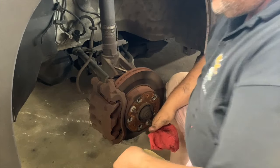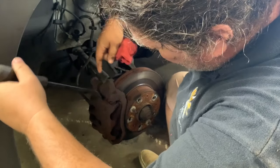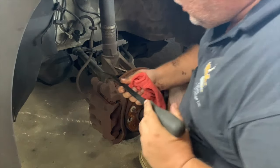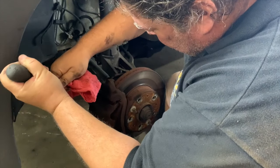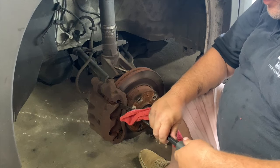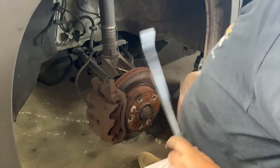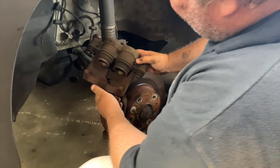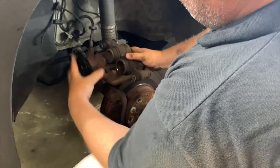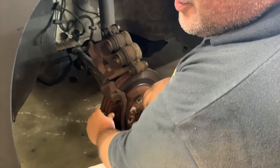Because I'm a professional mechanic, I have a fancy tool — this is called a pointed stick. You will have a long screwdriver, which is fine. All we're going to do is prise the caliper away from the bracket; there are a variety of places to get in there. There we go — see it come off there? It's leaving the pads behind it. There's a million ways to do this and they all feel wrong. It ain't rocket science: the pressure comes in from the hose, pushes these two pistons out, they squeeze — the pads are in here, they squeeze, it squeezes the rotor, and the thing stops. Fred Flintstone would have thought of something similar.